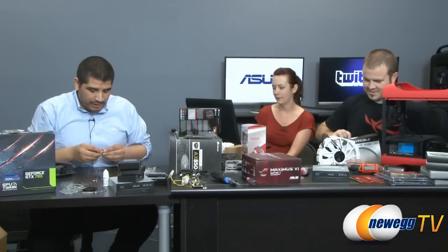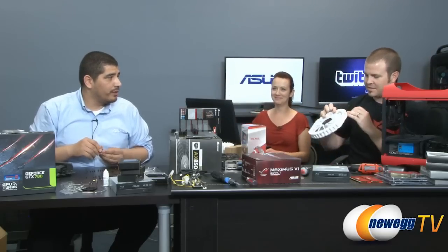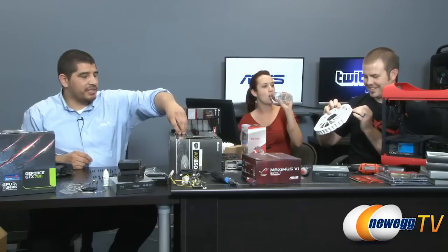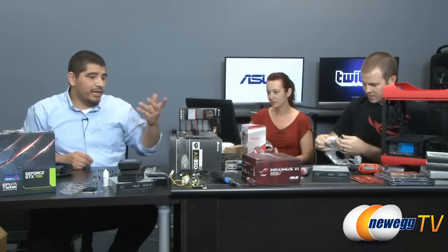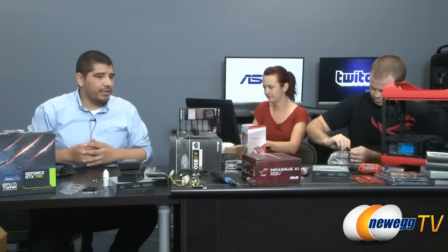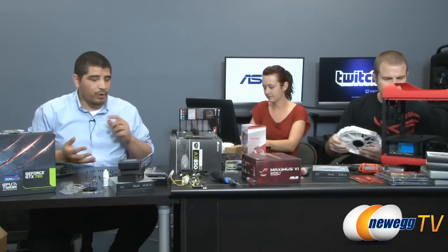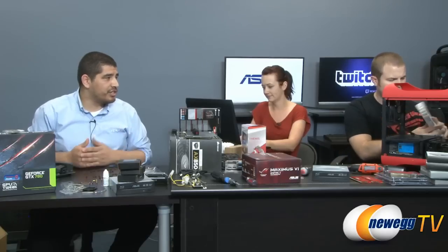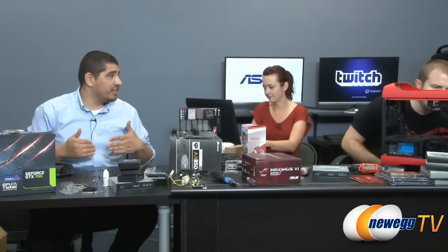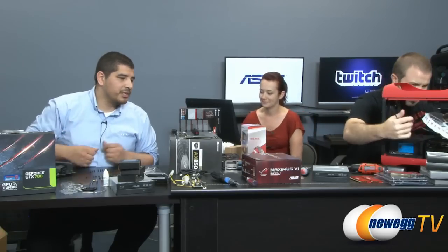But you make a really good point, Paul. I think that it's probably a more complex system that you have to consider as a whole when you're setting up a mini ITX, as far as things like thermals, space, and layout. Yeah. And I also agree, if you're taking a look at all the boards, generally there is a consideration that overclockability and certain expansion parameters are going to be a little bit more constrained. But I at least feel that there's enough mini ITX solutions that as a whole, from the quality, the overclockability, and the expansion, at least not relative to PCIe cards or storage, is going to be about just as good, right? When you talk about number of USB ports, integrated wireless, and all those things compared to a desktop-based board.